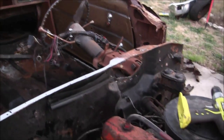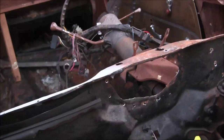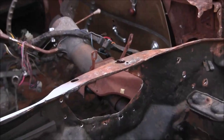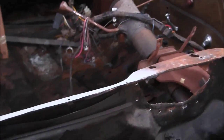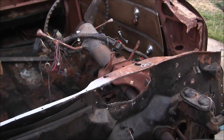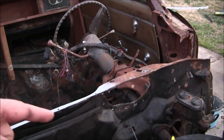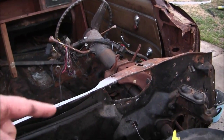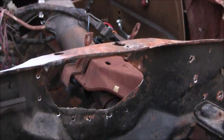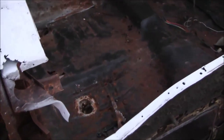They really did not want it coming loose around the windshield wiper motor. There are like a dozen spots all the way around where they spotted it all together. There's a plate in there that is actually attached to the upper vent cowl section rather than the firewall. The windshield wiper motor actually attaches to the upper vent cowl. There's a hole in the firewall for the windshield wiper motor, but that plate is part of the upper cowl assembly.